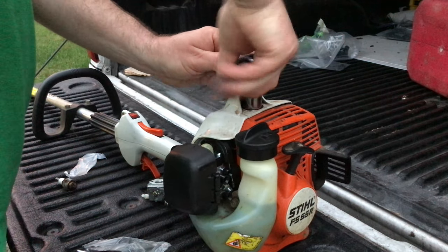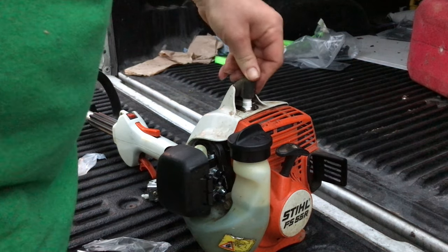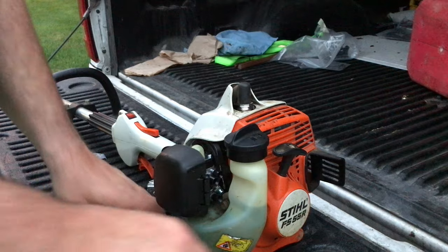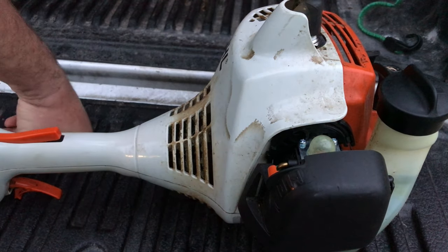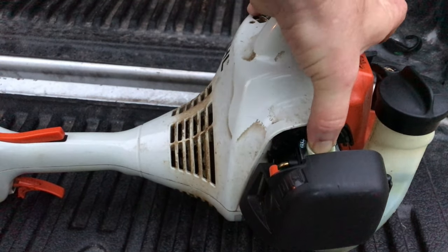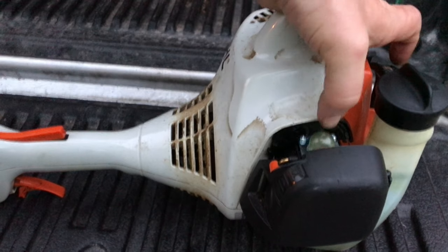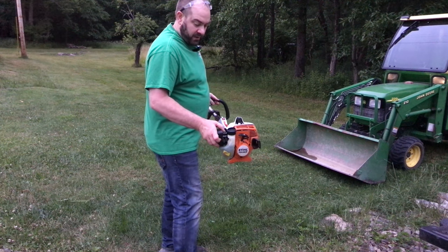I did not buy the Stihl brand kit — this is just an off-brand, and there are tons of different brands. I can't recommend one over another; I'll put a link below to something similar. I bought this as a two-pack when I replaced it the first time. Now this carburetor is going to have no fuel in it, so we'll need to prime it and get fuel flowing into the primer bubble. We'll follow the normal starting procedure — choke it, prime a couple of times.